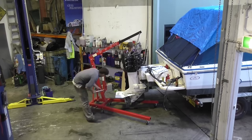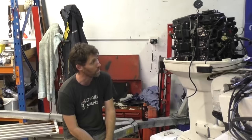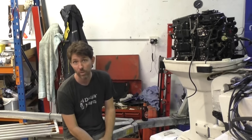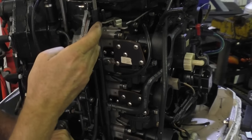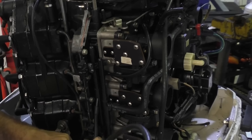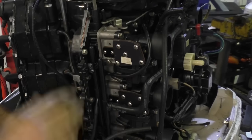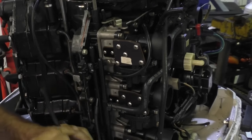I do have a few bits and pieces I'm not very sure about. I've got the service manual for it and I was expecting it to be a little bit more obvious. I know a lot of you guys are much more familiar with Evinrudes than I am, so hopefully you can tell me. Just here between the carburetors and the crankcase, there's a tube that the manual refers to as the balance tube. It goes behind each carburetor, but there's no indication where this other end goes and there isn't an obvious matching set of barbs where it should go — so if anyone knows, that'd be great.